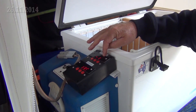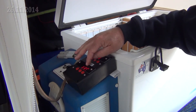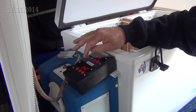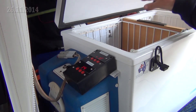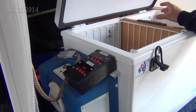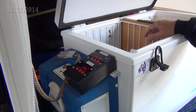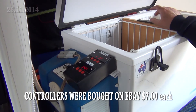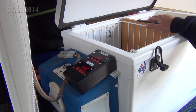This controller controls the temperature inside the freezer section, and the fridge controller is operated by the thermostat — set at four and a half degrees. So when the fridge side needs to be cooled, that triggers the fan to draw cool air from the freezer section into the fridge section, then it shuts off when it reaches temperature. You've got that other fan just circulating the cool air. These two controllers and the two computer fans are only drawing 0.3 of an extra amp, so it's making the box a lot more economical for minimal power usage.